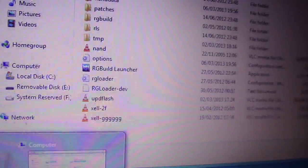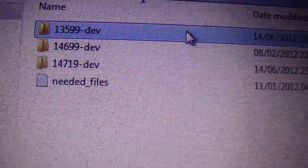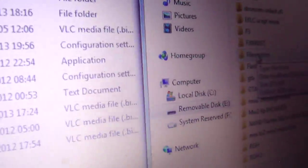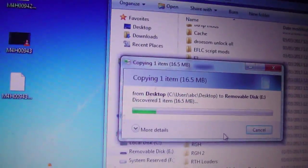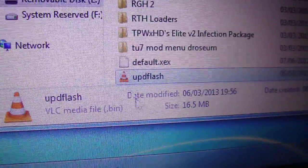You also want to get a memory stick — it doesn't need to be that big, mine's 8GB but you're definitely not going to need that. Go into file systems and delete 14699 and 13599 and the unneeded files. Then you can go back and just copy the file systems over to your removable disk — I've already copied mine over. Once you have done this, just drag it onto your memory stick and then we're going to rename it UPD Flash. It should look something like that — don't worry about typing .bin as that's basically all it is.